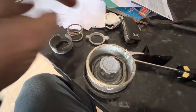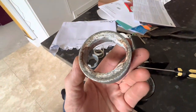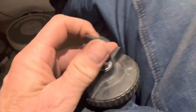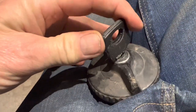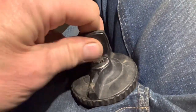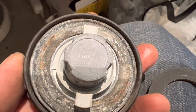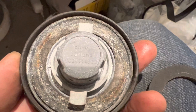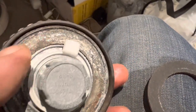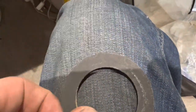Taking the locking ring out — that should in theory just tap out of there, but it's really stuck in there. Well, what do you know — we eventually got this lock working. Unfortunately I broke my camera stand today, but we eventually got this lock working with the master key that we got cut from Mercedes. Anyone who's interested, the part number of that fuel cap lock is 000 471 4930, and the ring or gasket that's in here is part number 110 471 0280.